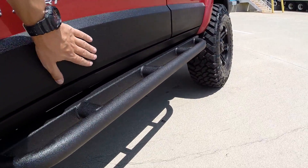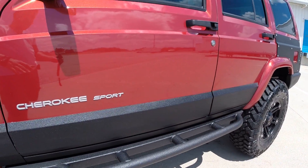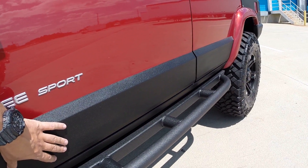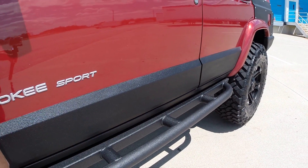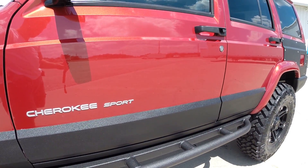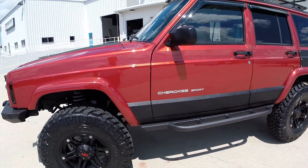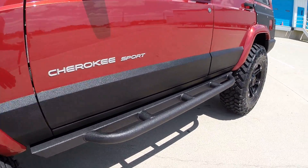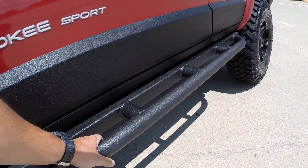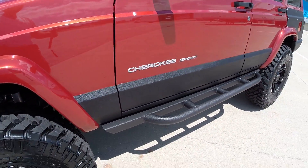This vehicle has our full Line-X package going all the way down the side. We treat it no different than painting the vehicle - we mask off the entire vehicle, it goes into our booth, we sand down the paint, spray a primer etching on there, and then apply the two-part Kevlar material. It gives it a beautiful finish - you cannot take that stuff off, it's rugged. We also did it to our rocker protector side slider with the built-in step. It's very heavy duty, gets attached to the frame as well as the pinch welds below, so it acts as both a step and a rocker slider.